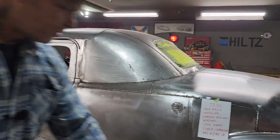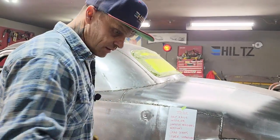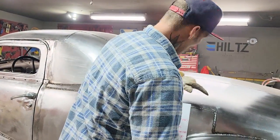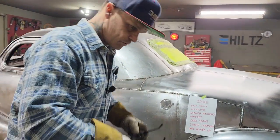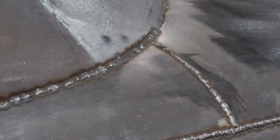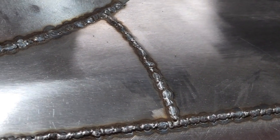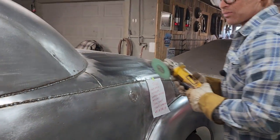So basically what I'm doing is a 24 grit, rubbing the head of the weld off. Before I polish it, I'm taking the 80 grit on a flapper wheel, just trying to get the scratches out of the 24 grit, because the 24 grit scratches up quite heavy. And then I'll do another one, while we got the air going, while we got things rocking and rolling. This pad that I'm using right now on the 24 grit is sort of worn out, but man, it's working good.